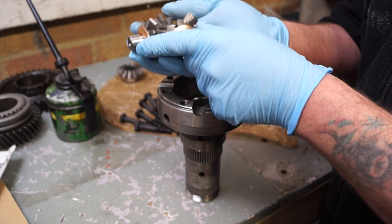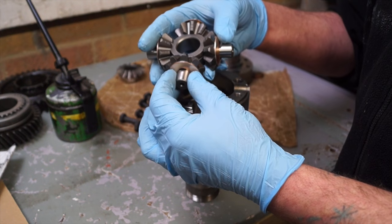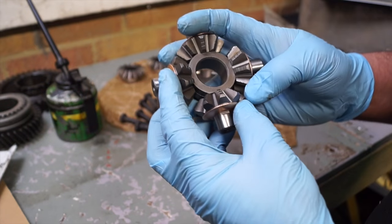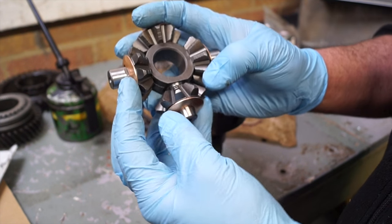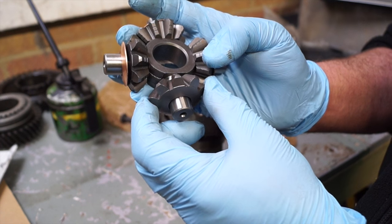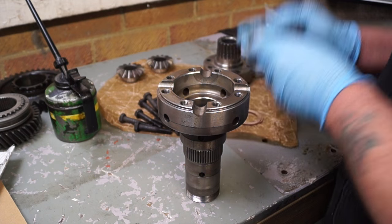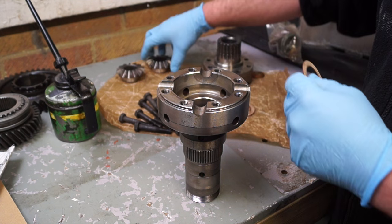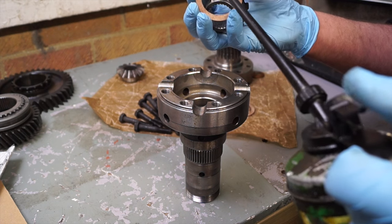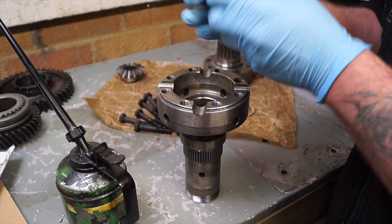Seeing this on Ashcroft's website, I thought I'd go for this because it's quite familiar to me. So we'll fit our components together with the domed washers in place. You can oil them as you assemble them, but you can also oil them when it's in place. Now I've got it like this — this is how it's supposed to fit. You have your planetary gears and a cutout there for oil feed. These new components are quite sloppy on the cross shaft, but these are okay — it's not a problem. What I'm going to do is put the sun gear and the thrust washer in and start to oil the components — not over-drench them, but enough to make sure they're not going to seize up on first start-up.